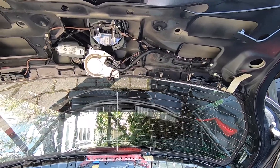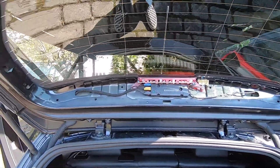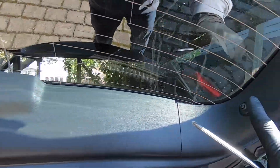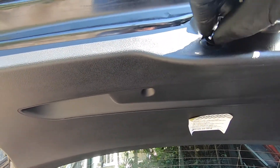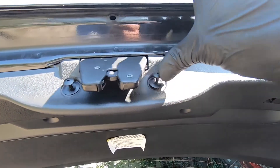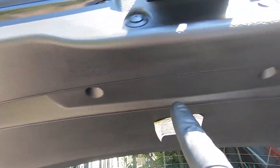This is just going to be a reverse of removal. We'll start with the main plastic trim, then do the two side pieces, then finish up with the top inner piece — they literally just snap back into place. Once all the black plastics are refitted, we can start by installing the two screws that hold the parcel shelf cords. Then next up we can reinstall the two plastic clips in their openings, and once they're installed we can refit the two T25 Torx screws.